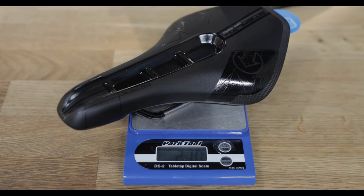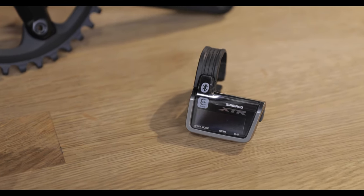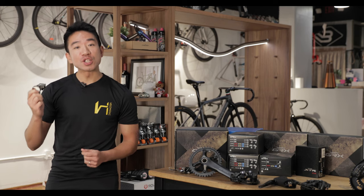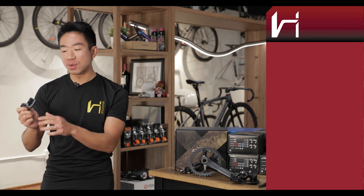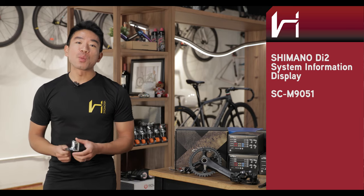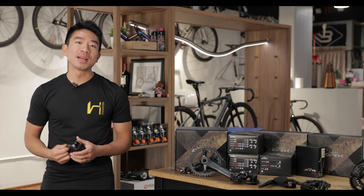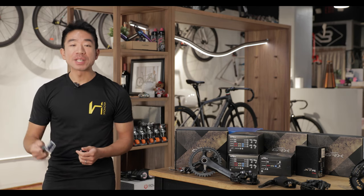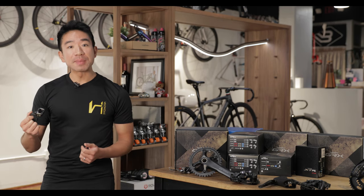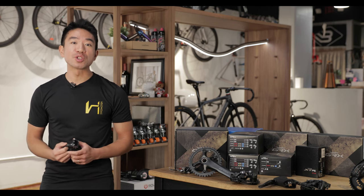One more cool part I'm adding to my build is this — the XTR display. It is a mountain bike part but it's wonderful for gravel because it acts as both a junction box A for those DI2 wires to plug into and for charging, and it also acts as a D-Fly wireless unit to communicate with your phone via the Shimano eTube app. On the app you can customize the display as well as update firmware. While riding, the display shows a gear indicator right in front of you and also shows your battery charge level.